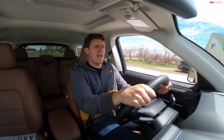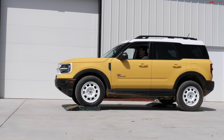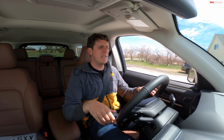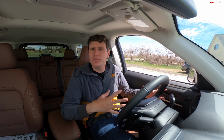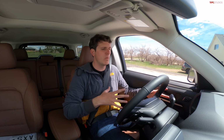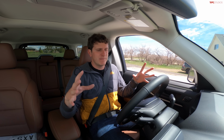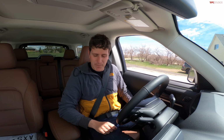All right, next up, the diagonal slip test. So the left front and the right rear are stuck in the rollers. The other two wheels on the ground are going to have to engage to get us unstuck. Very common off-road, but also very common in the snow in the winter. Imagine you're driving up on a snowy curb. You've got wheels spinning. This simulates that test, opposite ends of the car.